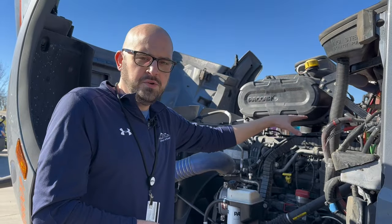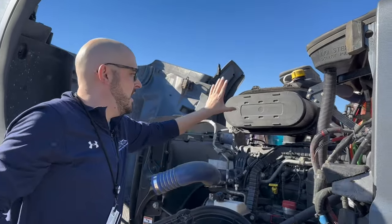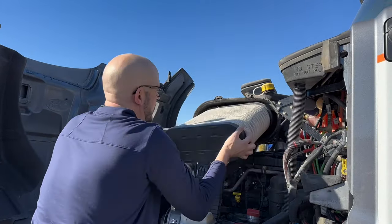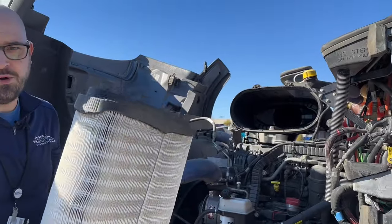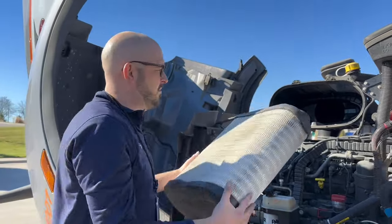I've already got all four of these bolts loosened. Once you do that, you'll just pull this front cover off right here and the air filter is right there. Basically, you just pull it out. You can see this one was changed pretty recently — it's not very dirty yet. Just pull it out, throw it away, and get a new one.